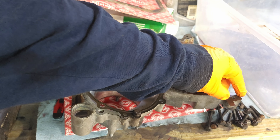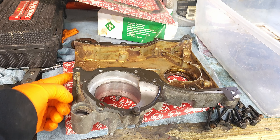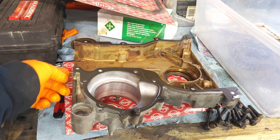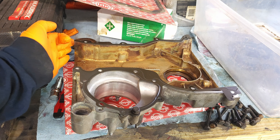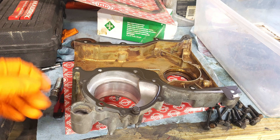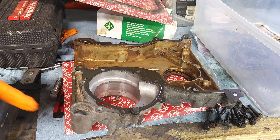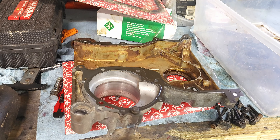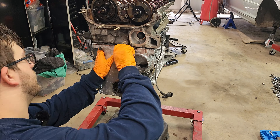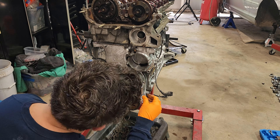With this, I've got two new gaskets here. Keep a bolt in there to keep it steady. When I put the oil pan on, I'm going to put a little dab of RTV on the bottom of these. But for right now I'm going to put a little bit along the top just because I don't exactly trust the head gasket mating surface while it has some rubber on it. I'm going to add a little bit more RTV along the corners where there's metal-to-metal contact. All these bolts around here are just this size — some longer, some shorter — and I'm going to torque them all to 10 newton meters.